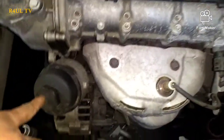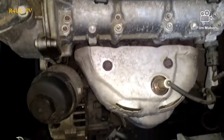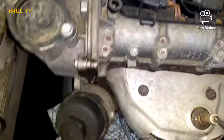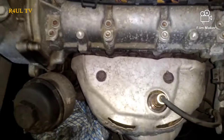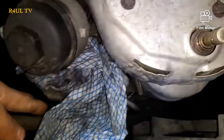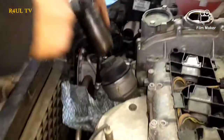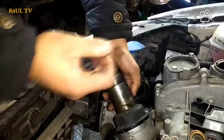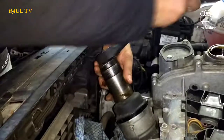What we're gonna do now is take the oil filter off — 36mm socket, dead easy on this one. What I recommend you do is put a rag or cloth underneath here, because when you take the oil filter out, oil can spill onto the alternator and the alternator belt and mess things up. Nine times out of ten, because it's a downward-facing oil filter there shouldn't be much oil, but just in case, put something like a rag there. Then just take that off — 36mm socket, anti-clockwise. Make sure you don't slip and damage your knuckles.